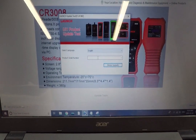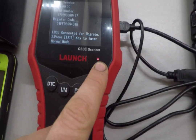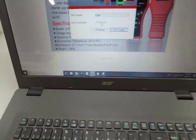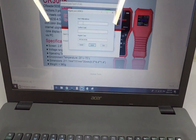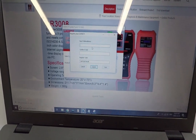What I'm going to do is connect it to the computer, enter my serial number, and start the upgrade. As soon as I plug it in, the light — when it's plugged into the OBD2 port it's green, but when plugged into the computer it's red. It brings up all the info, and my serial number field automatically populated. I'll do the device upgrade and fill in my contact info to register the product.